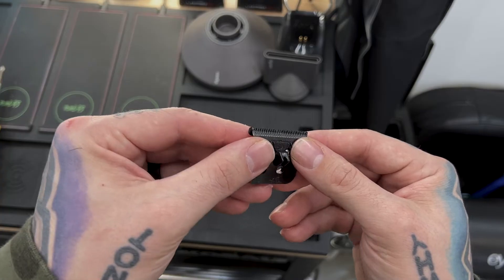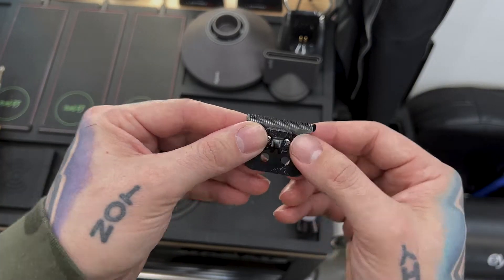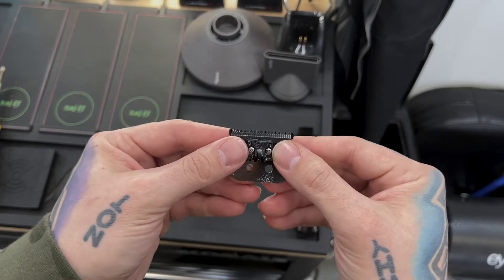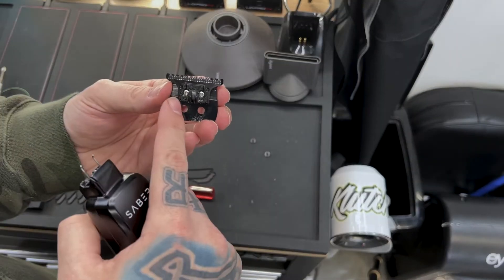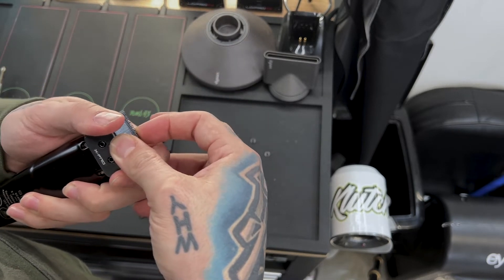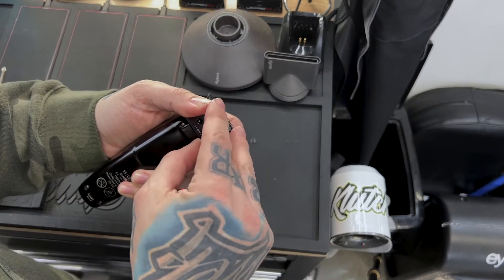I like a little bit less gap than that so I'm going to go ahead and use them like this and test them out. You guys just want to look at this blade and make sure it's not going over the top of the back blade. You can see if you look close, that thing is absolute zero — you can kind of see a little bit of the steel blade in the back, but this is set really close. Now we'll just throw it back on the trimmer. There are two grooves on each side of this black piece — we just want to put those metal tabs in there, press it down, and it should go over the screw holes. Once you have it over the screw holes, just throw the screws back in.